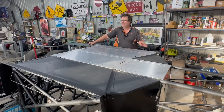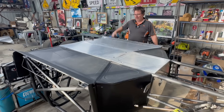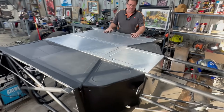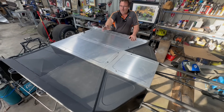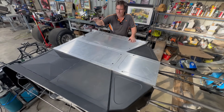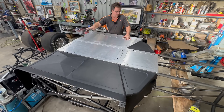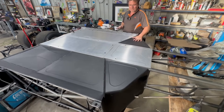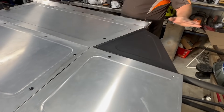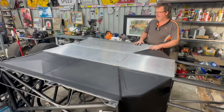Super exciting moment on Friday afternoon of week 10. We have completely finished the tin work on this car - from the rear firewall, front firewall, floor, everything. We are completely finished, locked out, she's sealed up and we couldn't be more happy with how everything's turned out. As we talked about at the start of the week, we've gone all steel in the driver's compartment - 0.95 because the driver's compartment is a sacred area, so we want to be a little bit over the top. We've done our three pieces over the seat bulge - they came out killer. Because of this big step down in the front area, we decided to put a steel one in there just because it's so much easier to have the removable panels all at the main rail height, then keep that dropped area steel.